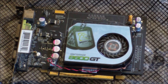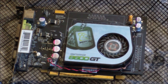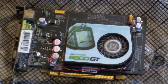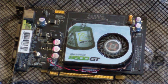The next piece of hardware is actually somewhat optional for most of you — it's a dedicated graphics card, which basically just displays everything on the monitor for you to see. Almost all computers nowadays have onboard graphics on the motherboard, so you can plug your monitor straight in. But there are still some motherboards that don't support graphics — which the one I'm using for this demonstration does not — so I definitely need a graphics card. And some people, even if they have integrated graphics, want more power to play intensive 3D games, so they need a dedicated graphics card.